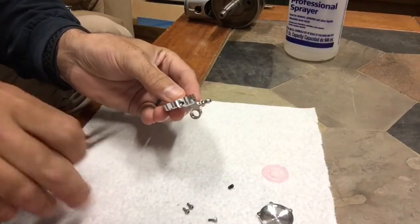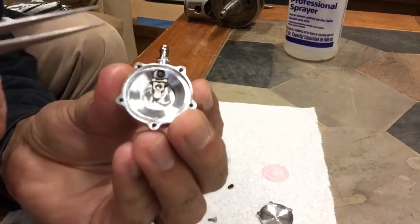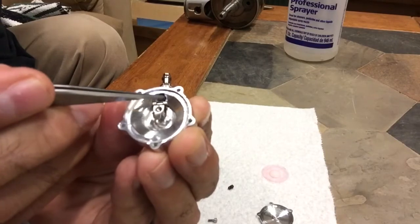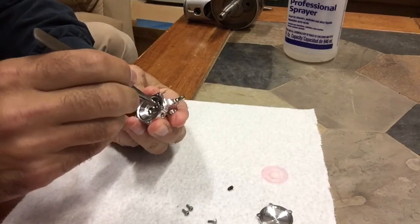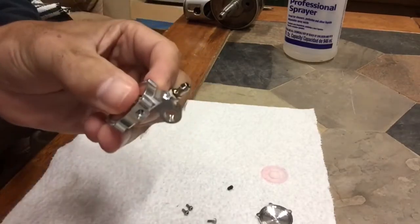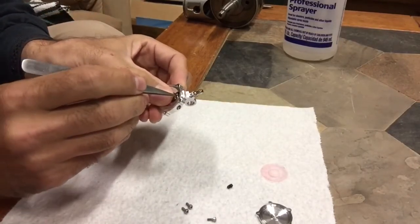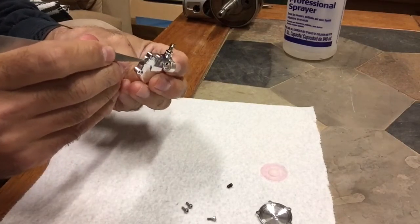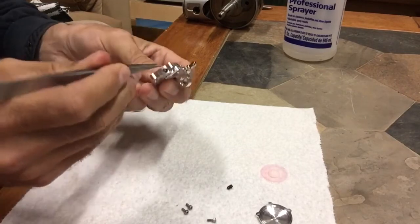The tricky part is actually removing the pin. There's the pin that holds this rocker assembly, right there. What you need to do is slide it to the side so you can grab it from the other side. Carefully use your tweezers — grab, slide, grab, slide. There's a spring under this rocker assembly, so hold your thumb on the assembly as you're sliding the pin out; otherwise the spring is going to fly out and you're going to be very upset. Once you have it scooted far enough out, you can grab the pin.